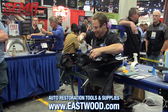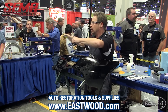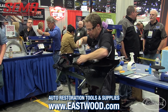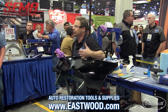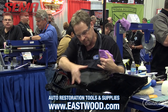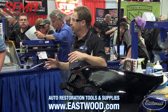When you're blocking and trying to remove — it's like chopping a tree, you're using an X pattern. When you're blocking a quarter panel with a long sanding board, you're blocking in an X pattern. I like to do the same thing with clear coat, using the flat part or leading edge of the sanding block because it's way flatter than my fingertips. You can feel the drag on that finish, feel the resistance — you can kind of tell when you've sanded through that top layer because it slows down.